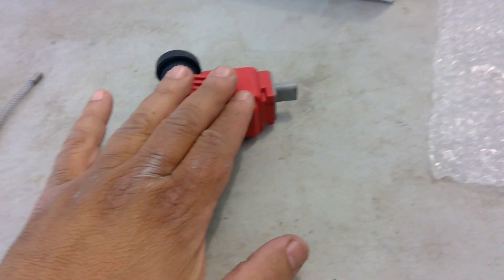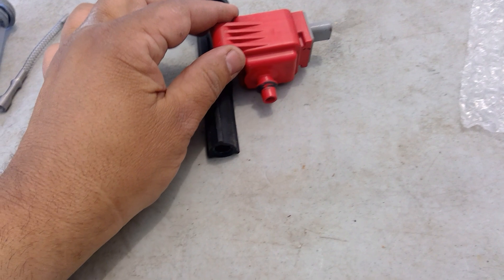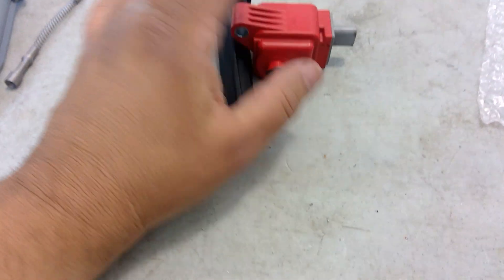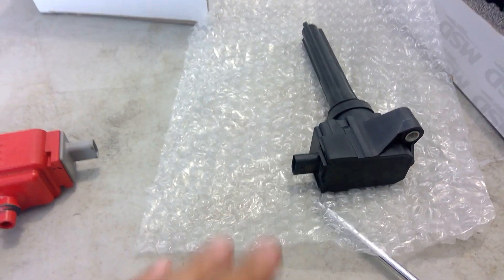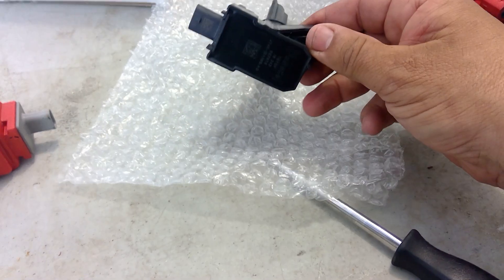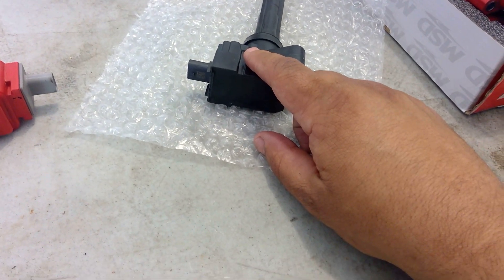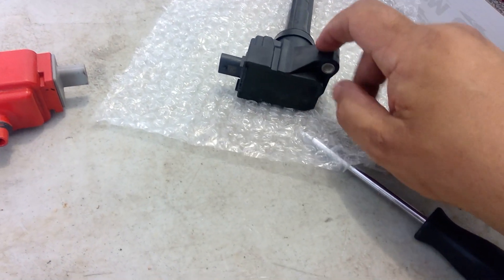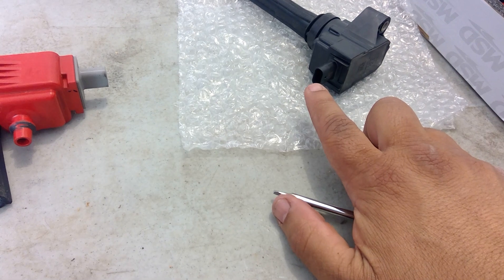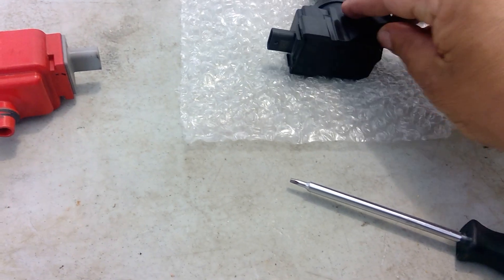A few of the others I also have the same problem, so what I may do is put these new boots on these coils. Another thing - don't drop these, alright? This has leads inside, module or internal igniters, whatever. There's a reason why they come packed in bubble wrap. And this one, for those who saw the older video, this is for the 2.0/2.7 EcoBoost. I think they started around 2018-2019 on the F-150, the ones with 400 pounds of torque. So this one obviously doesn't fit because the little notch is in a different location, so our wire won't plug in.